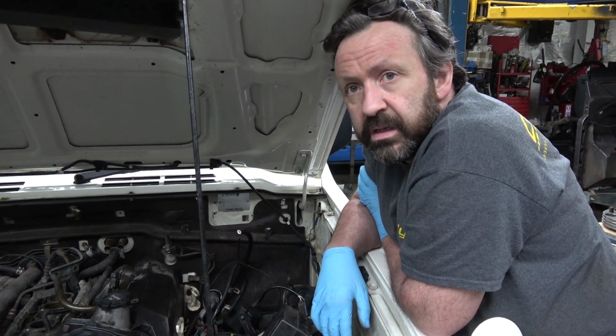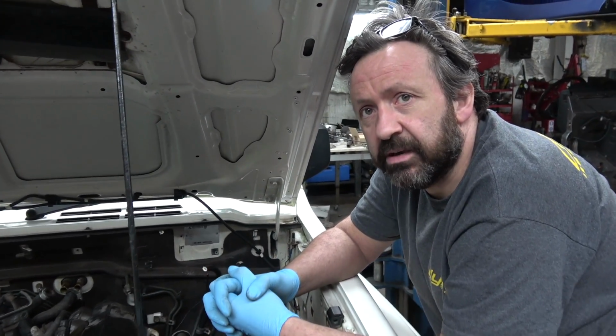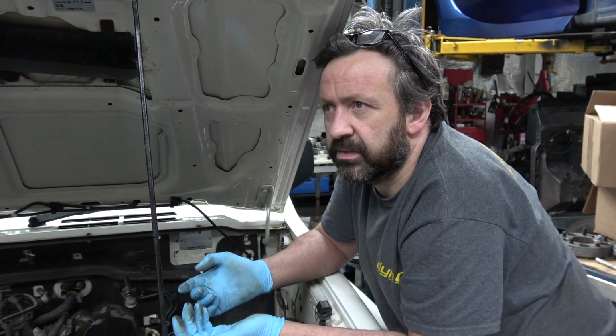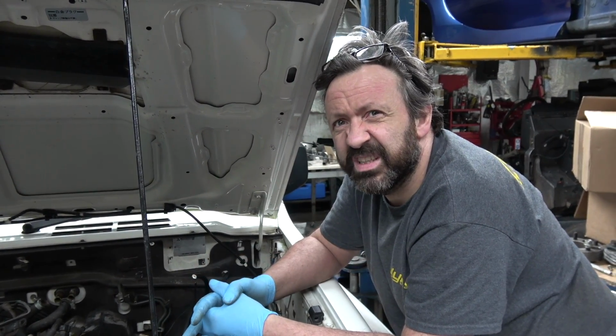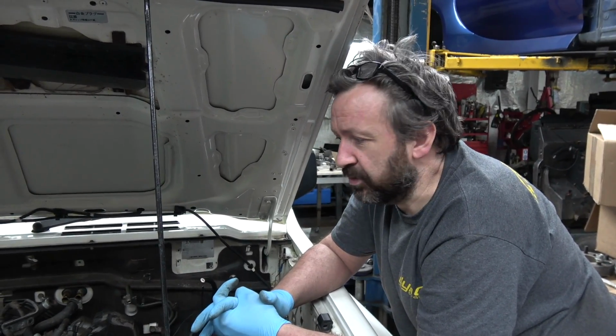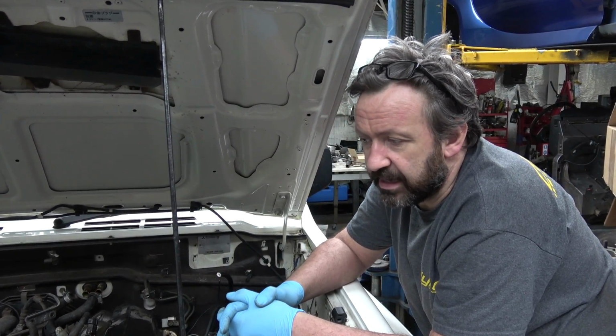With these 4.1 diffs? 4.2. But because of the size of the wheel, it actually works out. It's not bad. I think 70 miles an hour worked out at like 2,200 revs on the 10-speed, which is fine. I do like really long gearing because it just pulls so hard. But we're going to run with the original diffs for now.